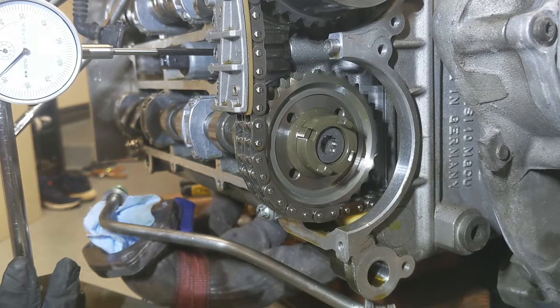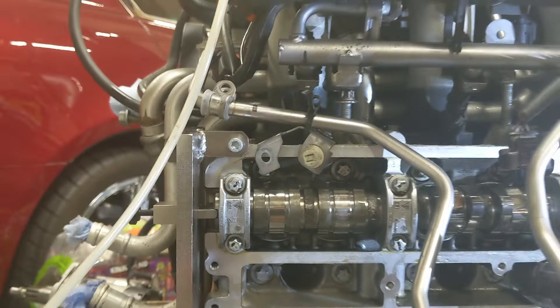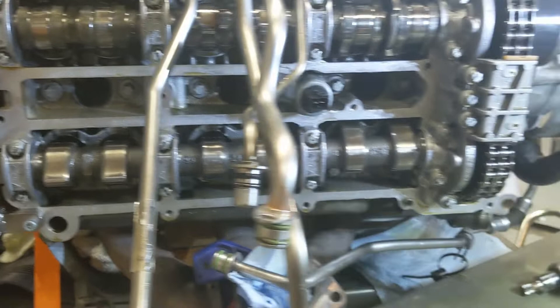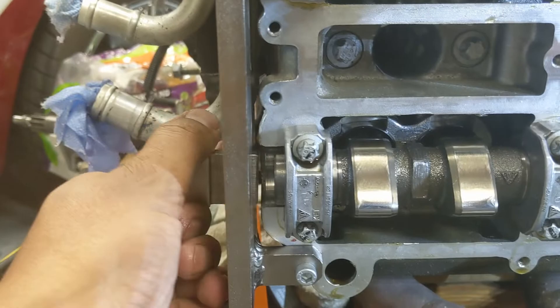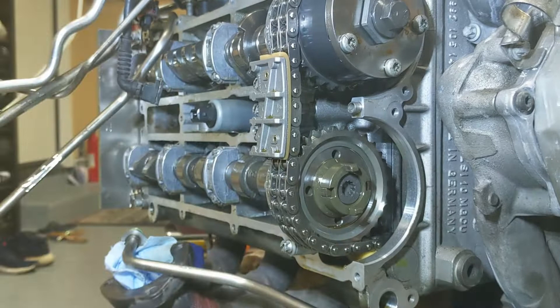That last snap you heard is essentially the exhaust cam spinning on me. I've got the top intake locked in. I'm going to try to adjust the exhaust and lock that back in with the plate. I've got the timing set with the plates for bank one. I broke the exhaust bolt off to adjust this because it was turning for some odd reason. Cam lobes are facing each other, plates are in.